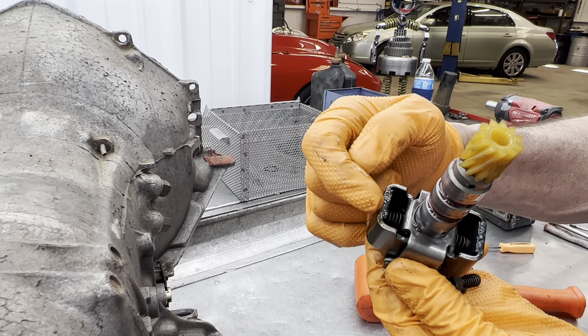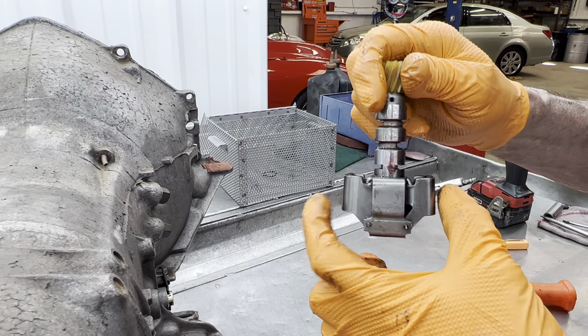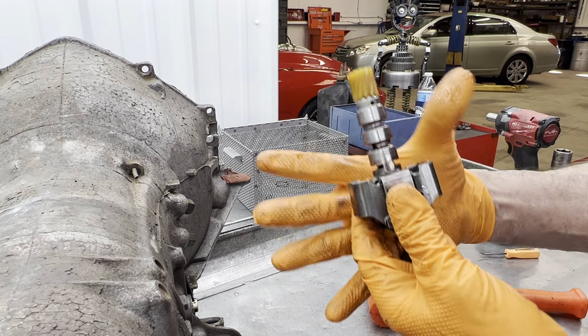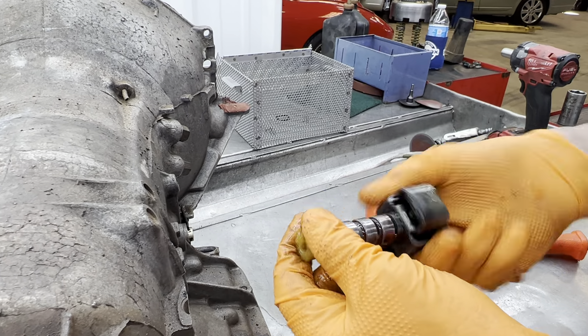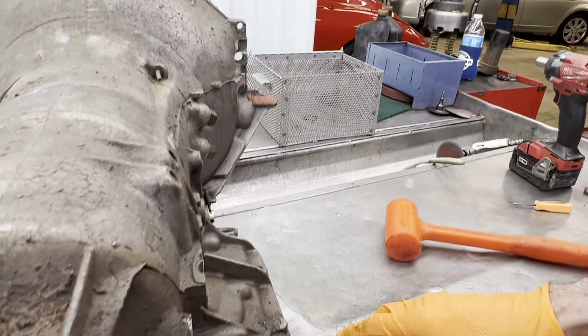You can see here, we welded the tab here — that way these are non-functional. And then we welded these here down in here so these don't move neither. We welded everything out. You can cut the gear down but we don't take it off — we want it to still stay in its same location but it will not spin anymore. That's how you make a fully manual governor right there.